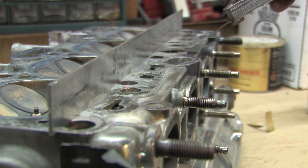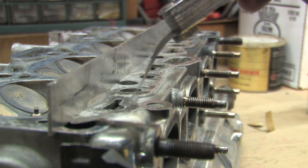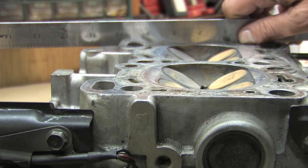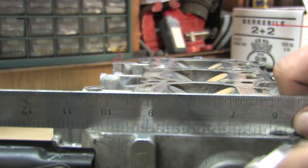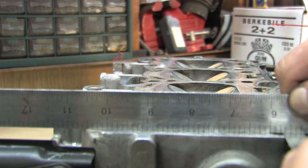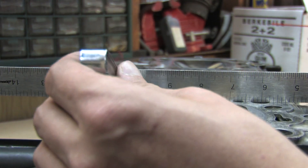It's also tough to find someone with the right equipment to straighten it like that, but they're right because it's possible to warp a head, have it decked, and then have it warp back again after a heat cycle. It's not common, but it's possible. The greatest risk of this occurs when the last thing the part did during failure was overheat.